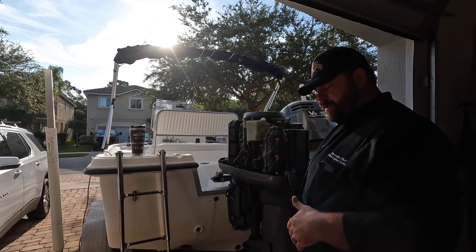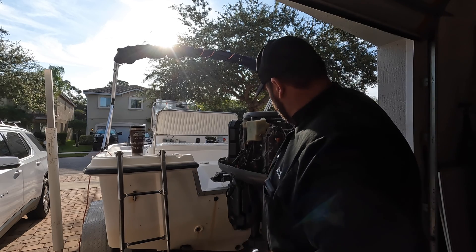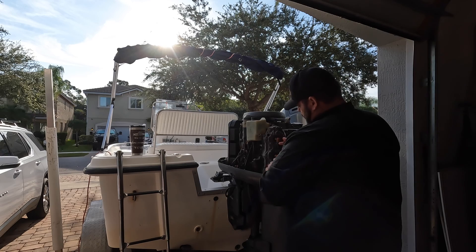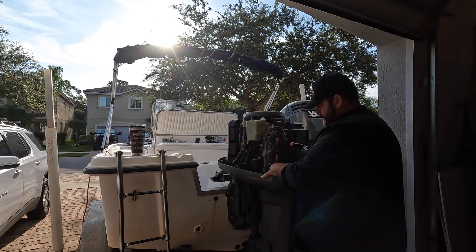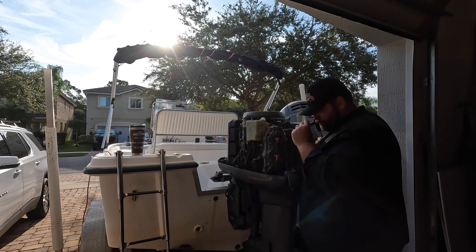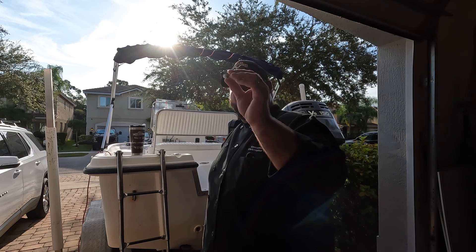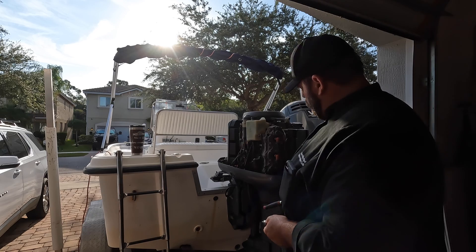I drive my beat-up old boat with my old Yamaha — it's great, it's lasted a long time. I started to replace some plugs and got to the bottom cylinder, which is the lowest cylinder on the engine. This is one of the old-school problems with the Yamaha: there's water in the lower cylinder. I filled it with oil last night, and this plug has rust on it, which means there's water in this lower cylinder.